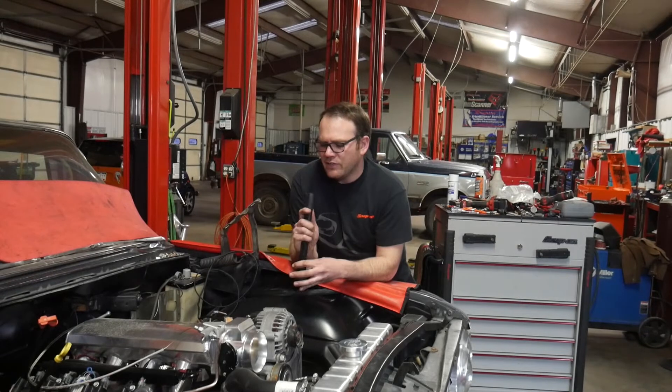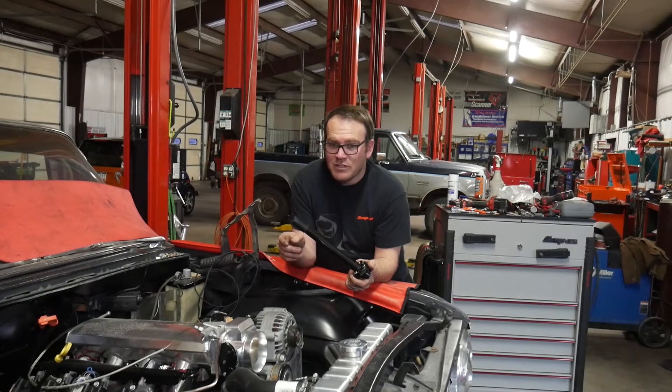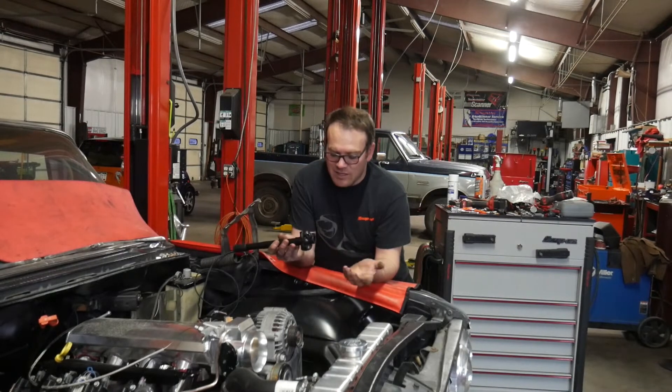This piece has a double D on the end if you have an aftermarket steering column with a double D shaft. I believe you can even use it as a slip shaft — it has a rubber boot on there. Or in the instructions, if you have a round shaft like I have, it says to cut off the double D portion, use just the round portion, drill a hole through it and put a bolt in it. We may also put a couple tack welds on there — we'll see how it pans out.